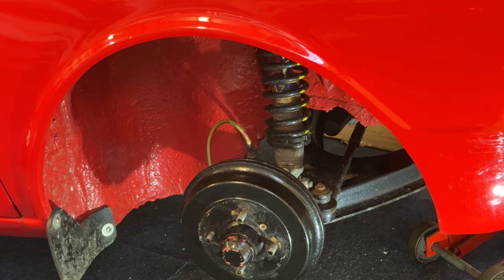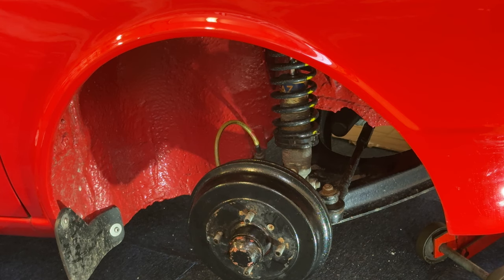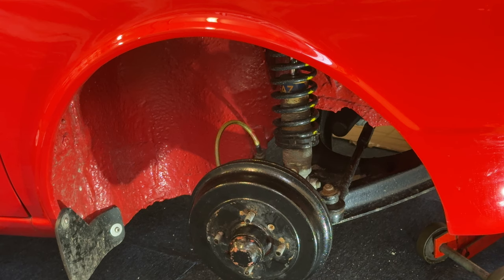There's no screw in this. Here we have it — it's the lights there at the bottom. As you can see compared to the Chamois, I've got double shockers on this and these are the gas ones, looking a bit grotty now. One thing I'd recommend to anyone who buys these shockers: if you don't want them to go discolored with the weather, give them another coat of lacquer, because they're just anodized and the weather attacks that. I've got one-inch lowered springs sat nice on the platform and I can adjust the height, set just right how I like it.